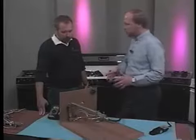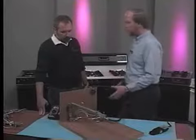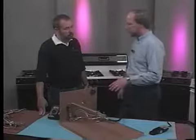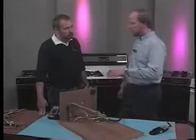So anytime you've got a glow bar, you've got a shutoff valve located on that appliance somewhere remote. It has to be in an area accessible by the consumer without tools and without moving the appliance. If you're a technician and you can't find it, the mini manual will show you where it is. On this particular model, the shutoff valve is located down on the regulator. This is your shutoff valve right here.